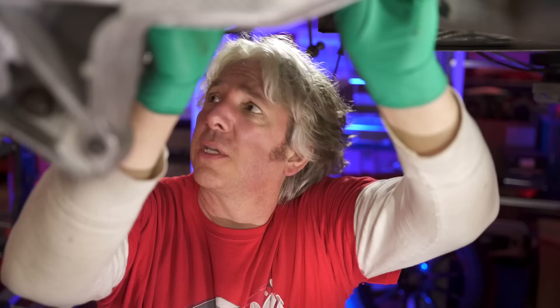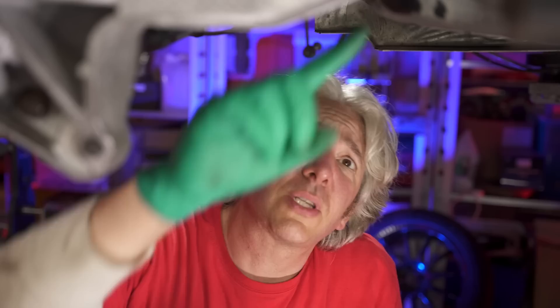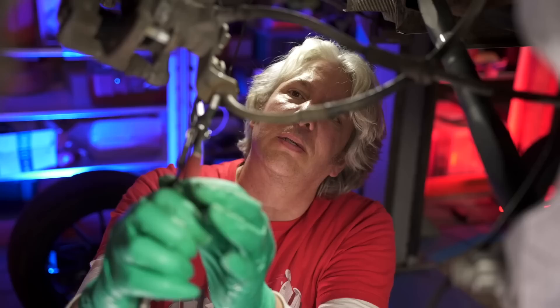Well, this isn't exactly ideal. Just trying to disconnect the flexi hose for the rear caliper here. I've got at least a bit of the steel pipe in the bracket still. It's obviously just twisted the pipe off and sheared. It's because the steel pipe is actually plastic coated to protect them from the environment, and that environment just whittled its way in between the plastic and the steel and rots it away. So that now needs to be fixed as well. I'm just going to try and disconnect the handbrake cable without breaking that.